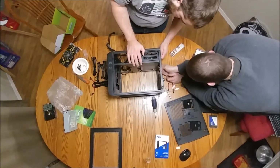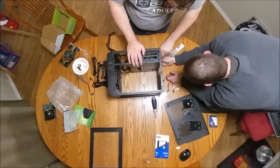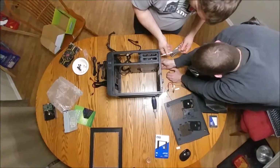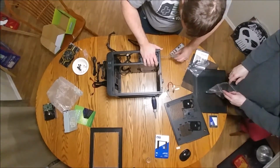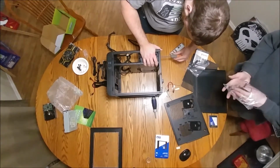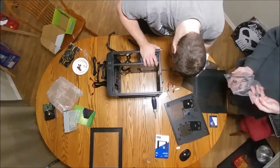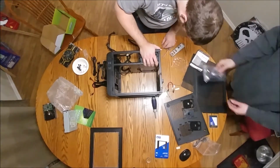I wonder why these are not wanting to torque down though. I'm thinking it's a thread issue. Like, it might be cross-threaded, or sometimes it happens, cheaper screw. We don't technically need to use this style. I would push it through. It is cinching down without going. It's spare parts that don't belong to anything just yet.